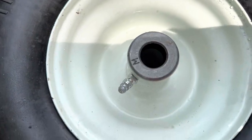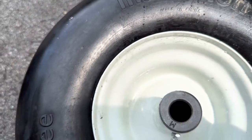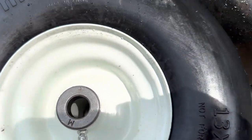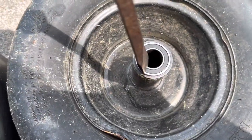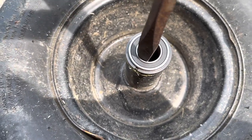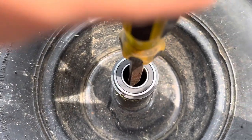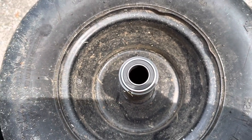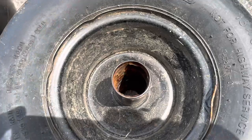We're going to take a long flat-tip screwdriver and put it down through here to the other side, knock that one out, then flip it over and knock this one out — they just slide out, you might have to hit it pretty hard. When you do this one, make sure you turn the screwdriver flat, not like this, because then you'll get into your bearing on the other side. You want it flat — stick it down in there like that, hit it with a hammer, go to the other side, it'll knock it loose, and then they'll slide right back into the new wheel.